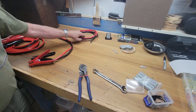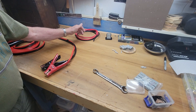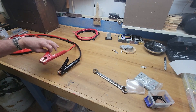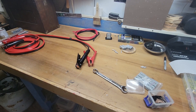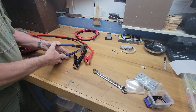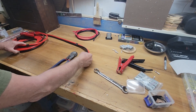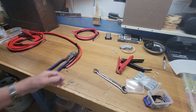I didn't have enough of my leftover wire to make the pigtail to go from the camper to the truck. If I bought a 10 foot length of number 6 wire red and black, it would have cost me about $40. The alternative is Harbor Freight — a pair of number 6 wire jumper cables, 16 feet, $18. So what I'm going to do is just cut the ends off and cut this 16-footer in half. This is going to be my pigtail to go from the camper to the bed of the truck.